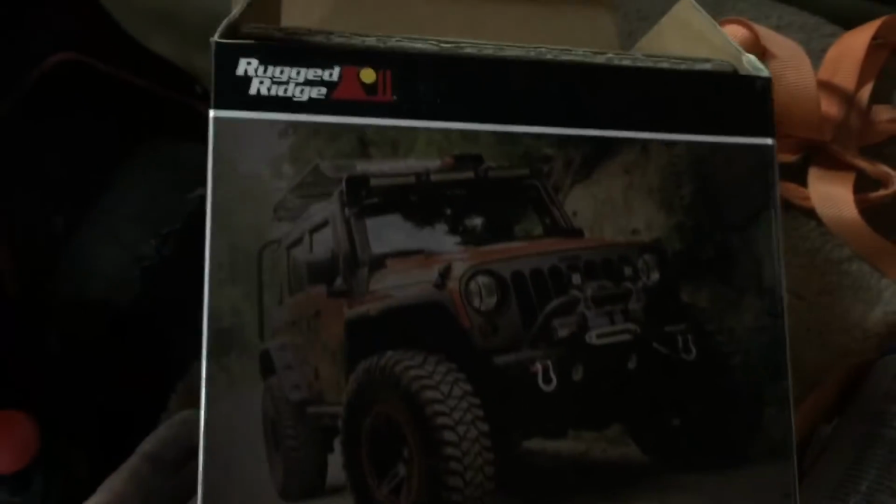Showed bleeding the front brakes there, but whenever you're bleeding a system, you always want to start at the furthest from the master cylinder, which is usually the back, and work your way forward. So that's what I did, but I only showed the fronts. So brakes are working. Here we go. All right, well, I think this is the last thing to all my struts.